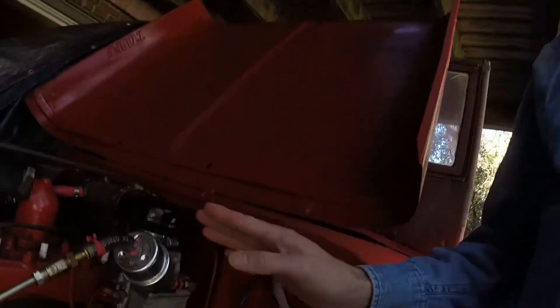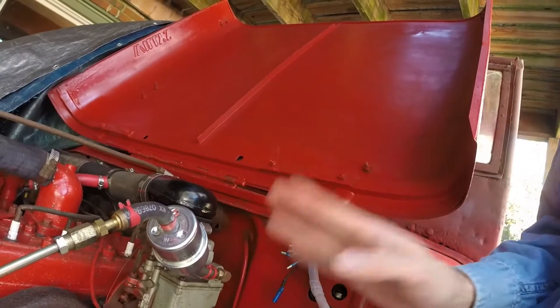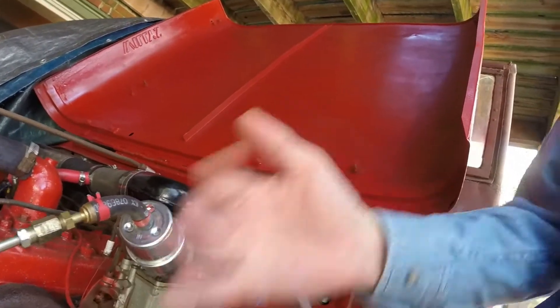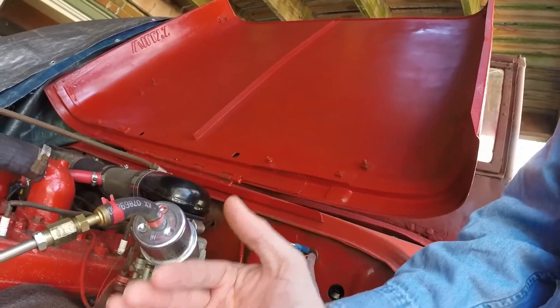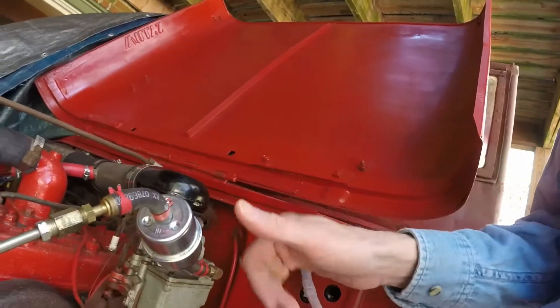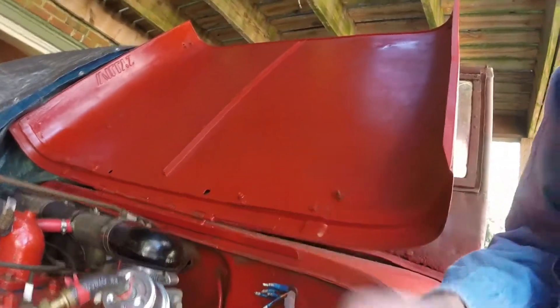One of the major changes I've done is I used to have a flex line sitting in here, and I went ahead and took that out and put a fuel filter in there. It's not particularly pretty the way it's set up — I had to put an extension here so it will miss my fuse box when it mounts on the fender. I know it's supposed to go straight in, but just a little modification there. I had a straight hose here, changed that out for the fuel filter, which freed up the steel line here for coming out of the tank if needed.